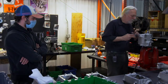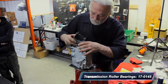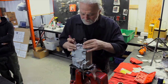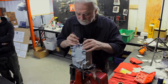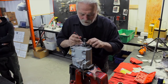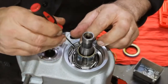Now, this is a brand new assembly, so in effect, we'll start with standard rollers. This has all been pre-fit. And we'll just add a few. Again, for a final check, I like putting these in dry. In effect, I feed these in and stand these up with a proper pick device. I highly recommend something non-magnetic, or a magnetic piece fights you. You're pulling the bearing back out again after you've installed it. So you can sharpen an old, tiny screwdriver, but you want to roll these into position, as you can observe what I'm doing here.